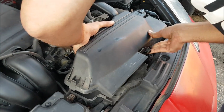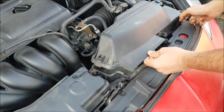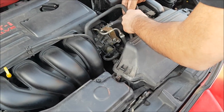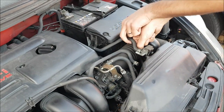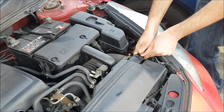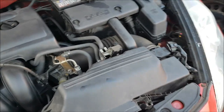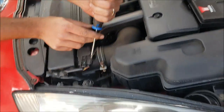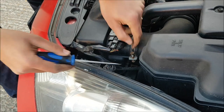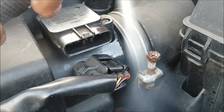So with the clips off, we've now got the three grooves or so that are on the air box out. I'm going to take off these hoses — that's one and the other one — and let's disconnect this. I'm going to need a Phillips screwdriver. I do need a WD-40 for that because there's rust. Yeah, we've got a lot of rust on that there, so let's just give it a WD-40.